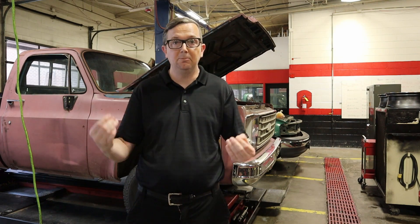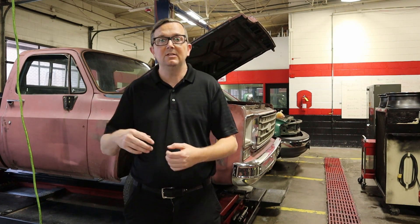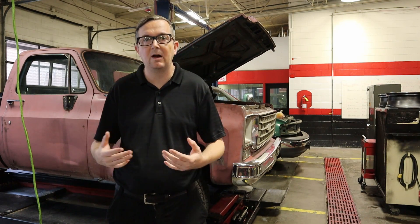Whether you have a temperature gun, an infrared temperature gun, or a thermal imaging camera — which is what I'm going to use today — I'm going to show you how you can take an exhaust system and look at it through the eyes of temperature and tell which cylinder is misfiring. This is very important to use on cars that don't have misfire recognition. A lot of cars before the year 2000, and even some later than that, did not have misfire recognition. It may tell you that the car has a random multiple misfire like a P0300, but to identify that misfire you had a couple of different ways you could use, and none were very efficient or quick.